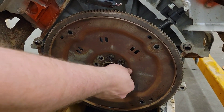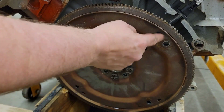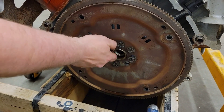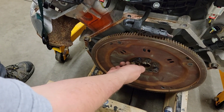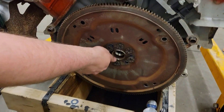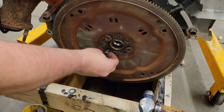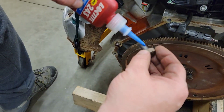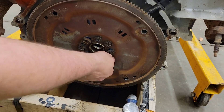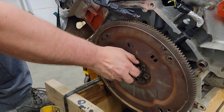Is there a reason it's shaped like that? They've got bigger heads. This is just because there's a lot of torque that goes through this — the torque converter flies on here, it's just a way to spread the forces and loads. Now we'll Google the torque specs for these. Good and tight, nice and snug.